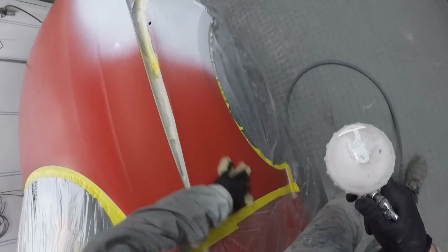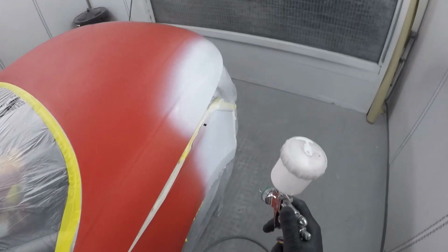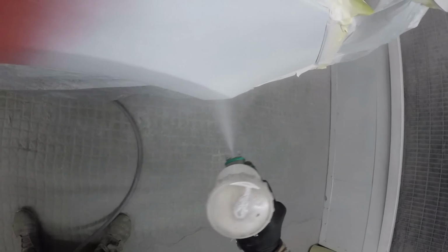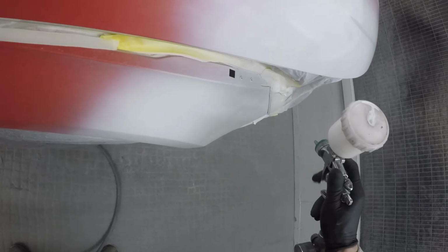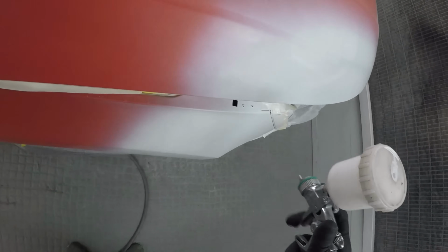We just want to make sure that that repaired area where we've got the grey high build is a nice uniform white colour, and there's none of that grey showing through, or there's no rub showing through on that area, and especially not having, say, a little patch of red showing through in the middle of that white. That would be quite difficult to colour up, and to make sure that you're not going to try and overcoat